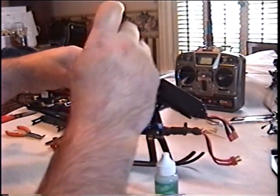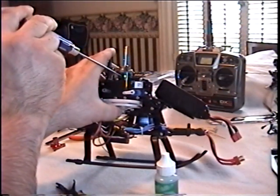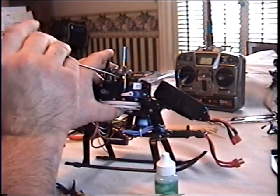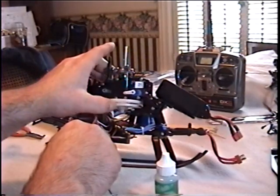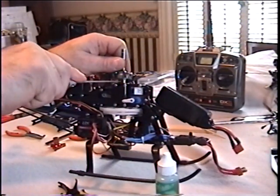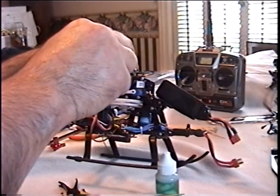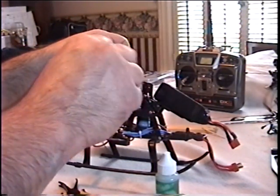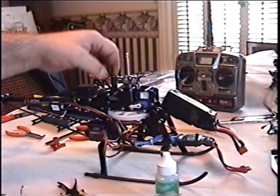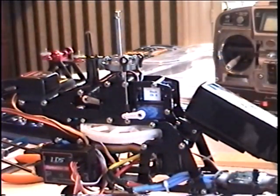I'm going to come back. I'm going to push up on the main gear, get the slop out. Tighten up the collar. I'll spin the main gear, get to the other one. There's 2 on the collar. Make sure those are nice and tight, but don't break your tools. Alright. Okay, so now we have a main gear replacement, and that's how Cruiseroy does it.